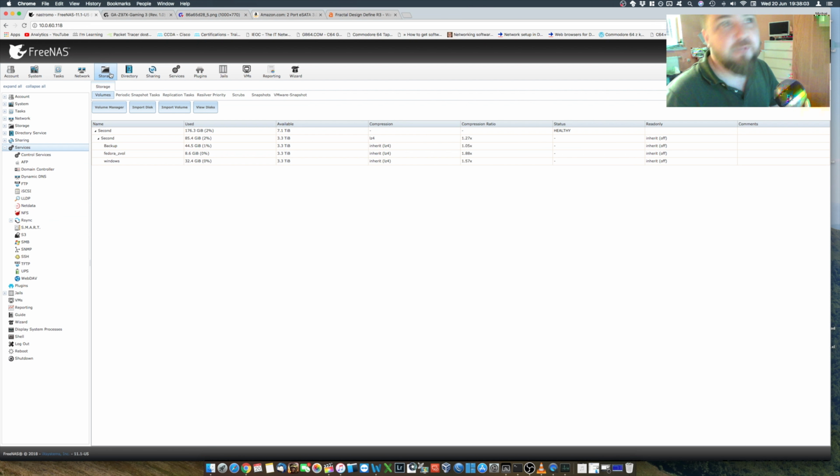DOMs, that's the advantage of DOMs. Most of them can fake SMART, and the BIOS won't notice, and FreeNAS also won't notice that this drive really doesn't support that. But for a thumb drive connected via USB, you just have to disable this. So that's one of the first things you should do.